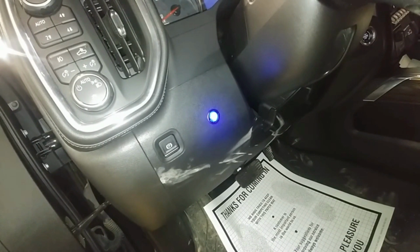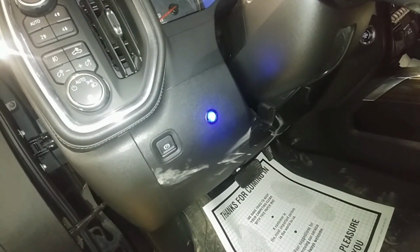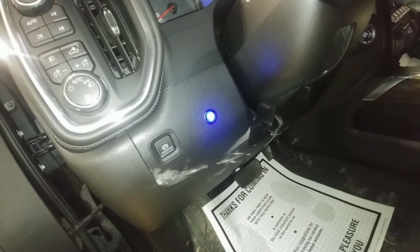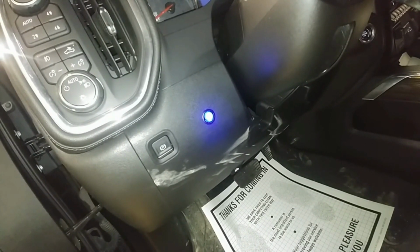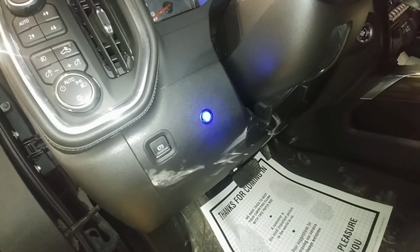You can see what I mean right here. That's where the factory auxiliary switches go. But if you don't have those, we can use that simple supplied rocker switch right there in the position that the factory auxes mount. That way, if you ever do decide you want to put the factory switches in, you'll cut that rocker switch out. There'll be a large rectangle you cut out there, and your factory switches will go there instead.